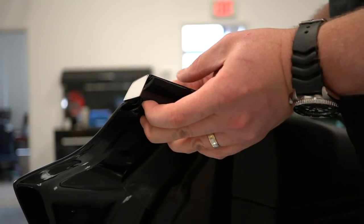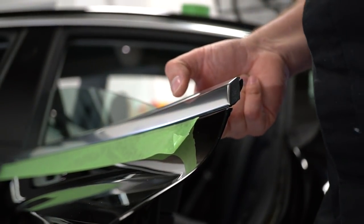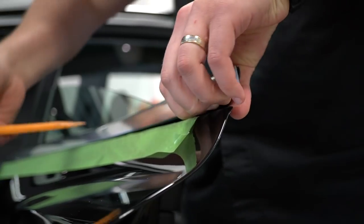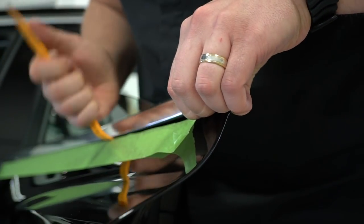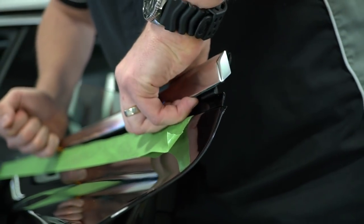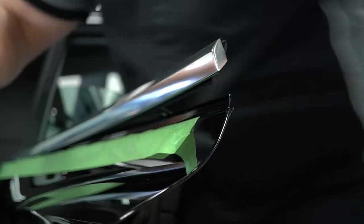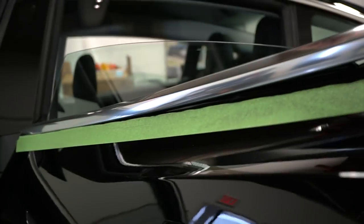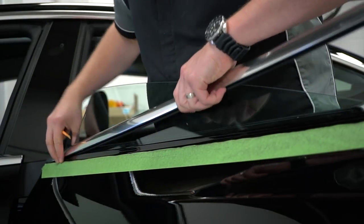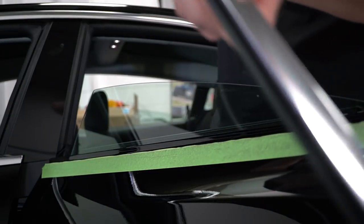Once we have that, we're gonna open up the door and I'm using a plastic pry tool. I'm gonna pry along the bottom area that's taped down and then pull the chrome molding as I'm prying with the plastic pry tool. Just give it a little bit of pressure — you don't want to pull too fast or too hard. This aluminum trim is pretty soft so if you pull it too hard you can actually bend it or scratch the paint. So the slower you go, it will come out — it is a little bit of a pressure fit in there.